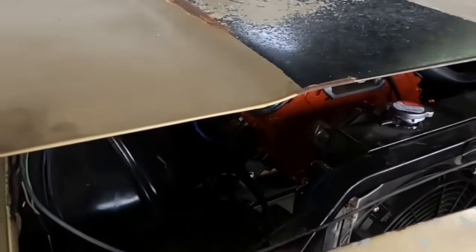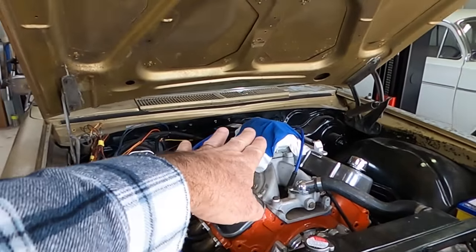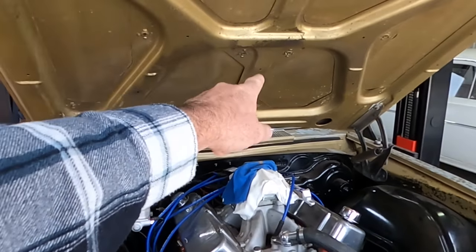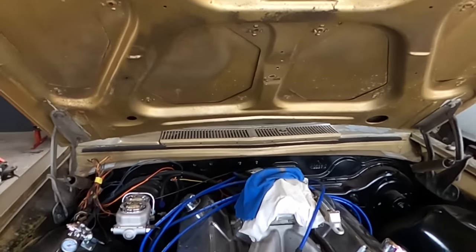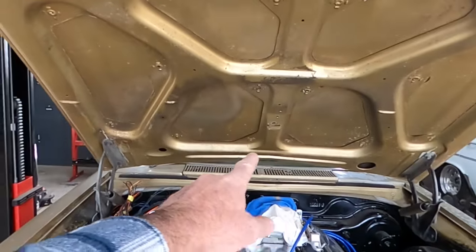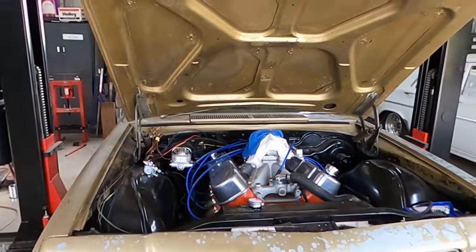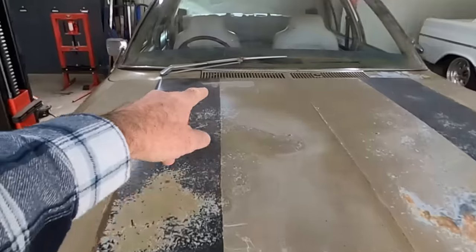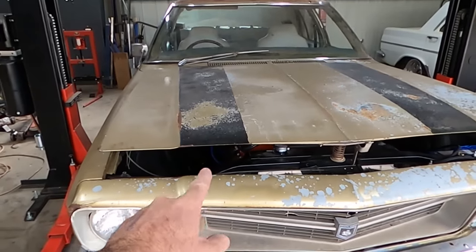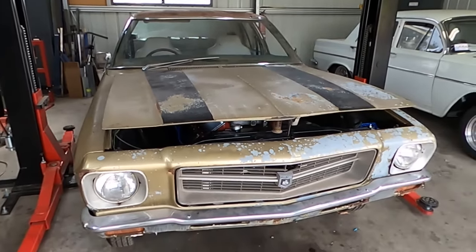And then I'm just gonna pull the bonnet down onto the top of the carburetor, mark where the vent tube touches the bonnet, measure back, drill a hole, and we'll just start from there. I'm not gonna cut a perfect round hole for an air cleaner. I'm actually going to take a fair bit out in a big rectangle, just to let some of the bad air out, or the good air in, or whichever. And then we'll get him stuck to the top here and screwed down, and then do something with these stripes that make me tick. Anyway, we'll stop talking. Let's get into this.